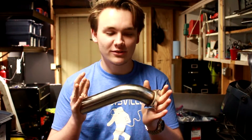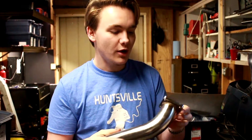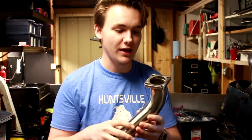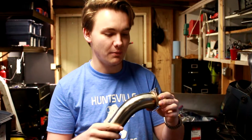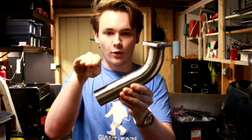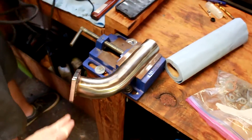The wastegate piping - if you're looking at it, this is gonna be the passenger side and this is the driver's side. It immediately hits the frame. So we're gonna have to do a massive series of pie cuts or some type of modification to basically make this bend almost immediately going out. It's going to take probably forever but we've got to do it.